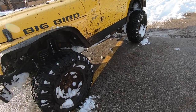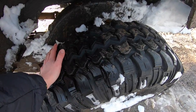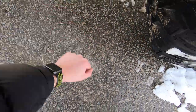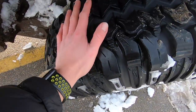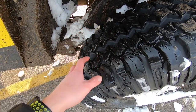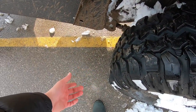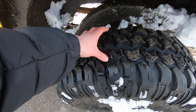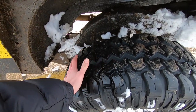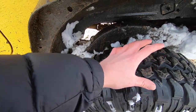And one quick way you guys can do that is the chalk test. And if you don't know what the chalk test is, once you have your tires on, go and put a little bit of chalk on your actual driveway and drive over the chalk. Like, paint a line or draw a line and make sure it's nice and thick. And drive over that chalk line and take a look at your tire tread and see which points of the tire are touching and which points of the tire are actually getting chalk on them. The other way of doing the chalk test is putting the chalk on your tire, putting a piece of paper down and driving over that. That way works great as well. Honestly, both ways work great. It all depends on which way you want to do it. Personally, I like the first way because that way I can see what the tire picks up instead of dust and stuff falling off of the tire onto the paper. But you can do it both ways.